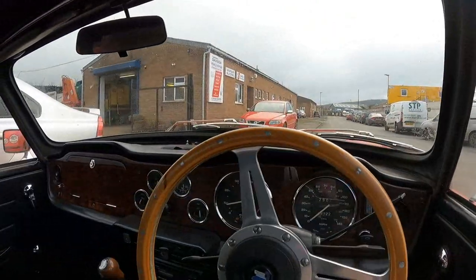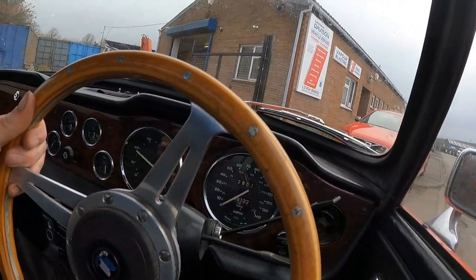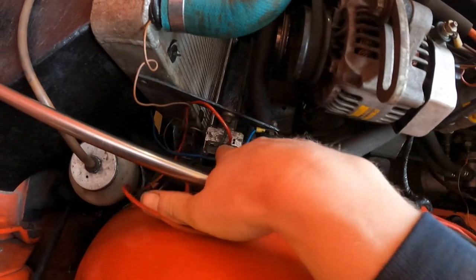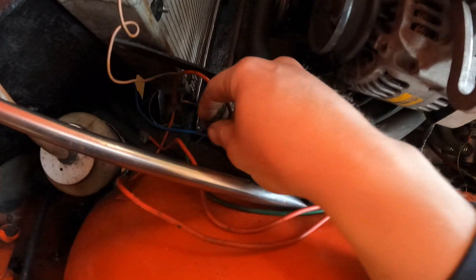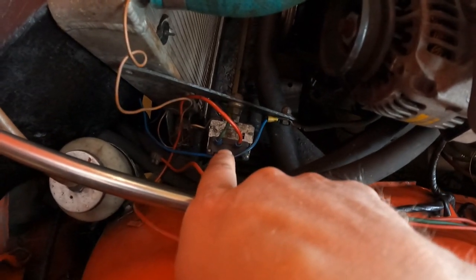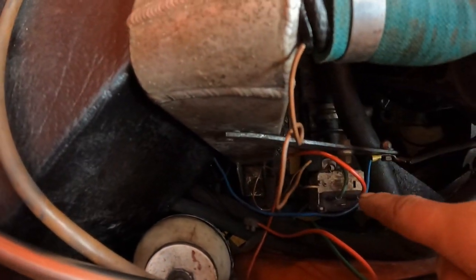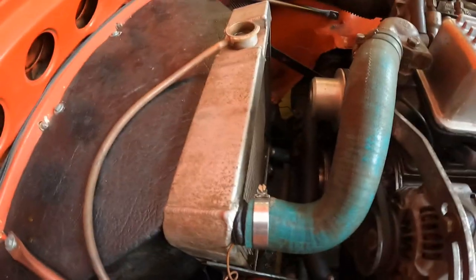It's got a fan wiring to repair on it because it's got a fan problem. So this is the switch here - it runs if you run it off this terminal here instead of that one, which is an ignition live. So if I run that one to there where it's supposed to be, it doesn't run. But I'm looking here - it's on a thermostatic switch which runs from here, and to be honest the wires are a bit of a mess. I might tidy that up while I'm busy.